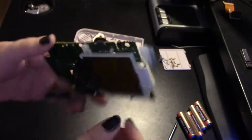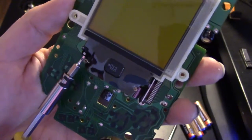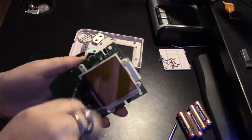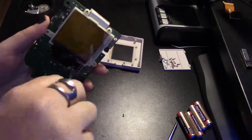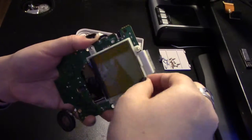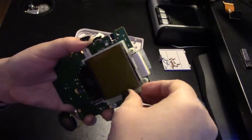If you're wanting to add a backlight to your screen, here's how. You have to remove these two tiny screws — this is where your little jeweler's flathead or Phillips comes in. Carefully remove the screws, and then very carefully slowly peel back the screen and it will pop off.